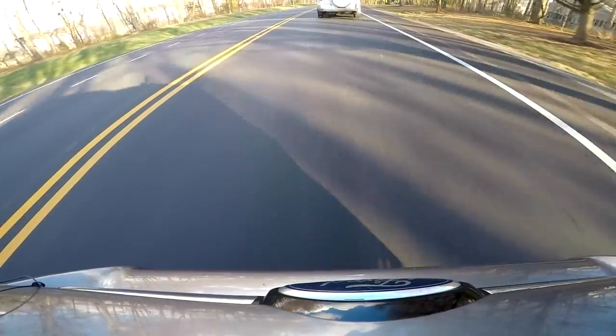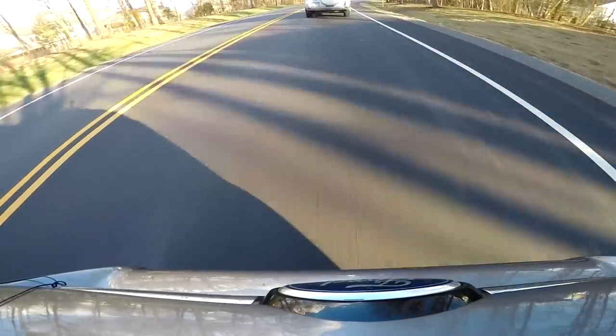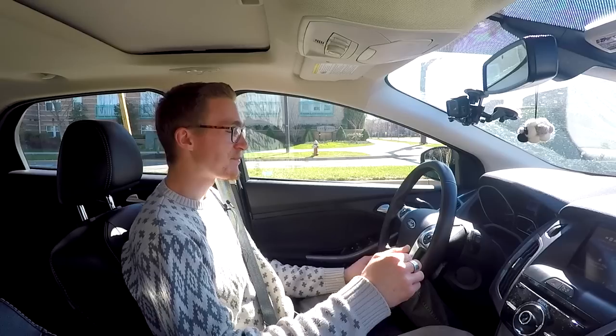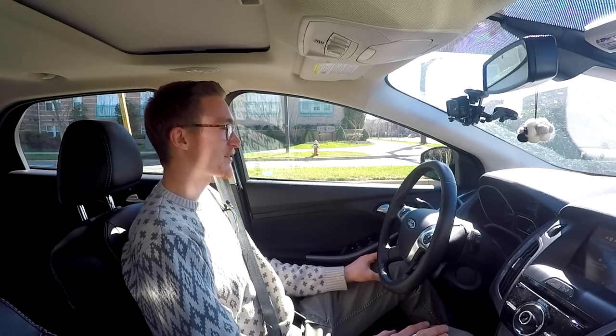Like a lot of you guys said, it's a lot more of a short ram intake. A true cold air system draws air from an area much cooler than the engine compartment — you normally route it down into the wheel well so it can pull in cooler air. I didn't do that, so once the weather got really hot, I was losing power bad from heat soak.